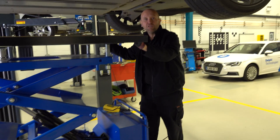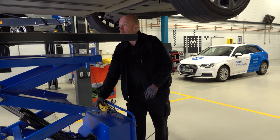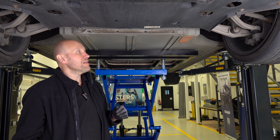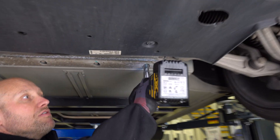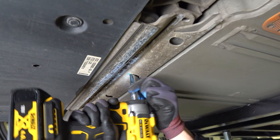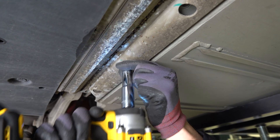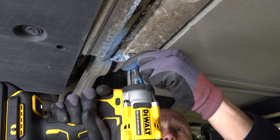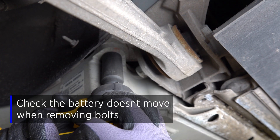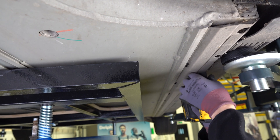The battery table is located underneath the vehicle — we're now going to raise it up and support the weight of the battery. Now we need to remove the front bolt for the battery pack, 13mm, and we're going to move across. And the two remaining 21mm bolts on each corner. Now we're removing the bolts along each rail.